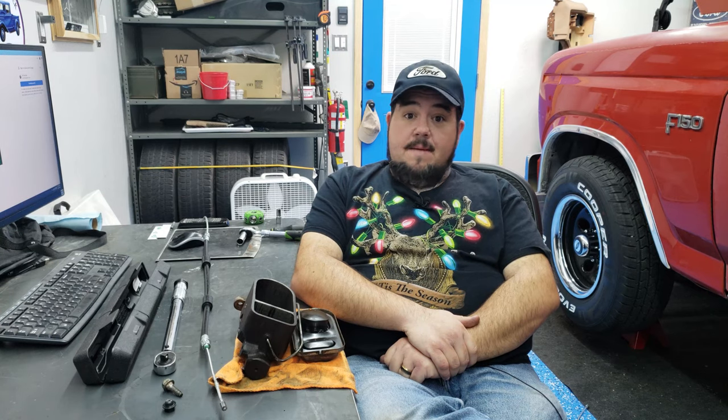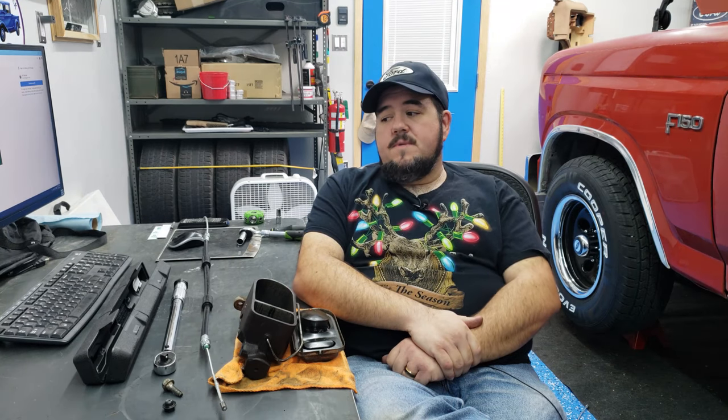And I noticed when I was doing that, the truck pulled to the left a little bit as I was braking. So obviously that's something we have to look into. But other than that, everything seemed fine. The truck felt good. The brakes stopped the truck okay. The brake felt firm. I wasn't having any other problems.